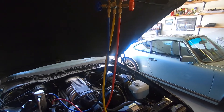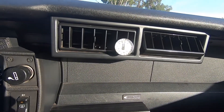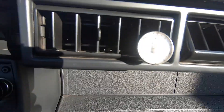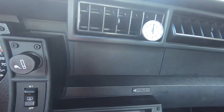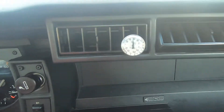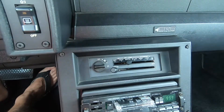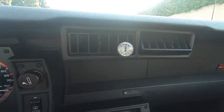Let's disconnect the can setup and test out the temperature inside the vehicle. You can see the temp gauge on our mechanical meat thermometer — it's about 50 degrees and holding. Getting some air across the condenser, it stays rather cool in here. I've got it at a normal setting now after cranking it on max for a bit. We can call that a success! That's another episode complete — our three-part series. I just took the car for another spin: 50 degrees at the vents with max AC on, going down to maybe 57 in the medium range. Literally chilling, super cold.